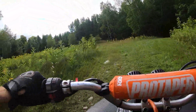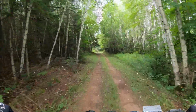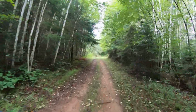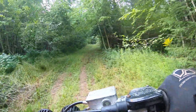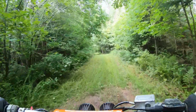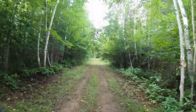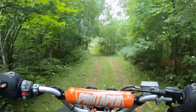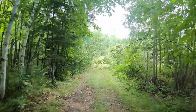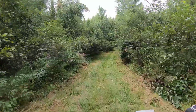Before, I could go into corners, I could slide and everything just fine, but the biggest thing is the rear end would kind of jump, would kind of chop regardless, if you were hard on the throttle or just rolling into it. The back end would chop and skip, and you'd have to really fight the front end to get it to come around and do what you want. It wasn't a smooth transition in or out of the corners.